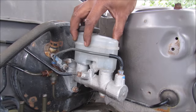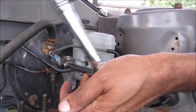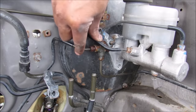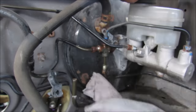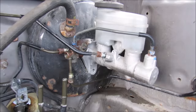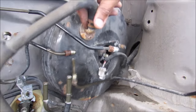To remove the master cylinder off of the brake booster there are three 12mm nuts that go around the circumference. On this particular master cylinder these two lines go out to the proportioning valve, so I'm going to remove them. With all the lines free I can remove the master cylinder, and with everything free I can remove the booster.